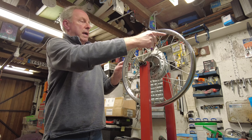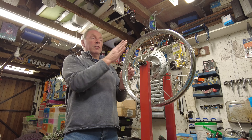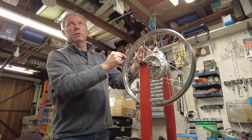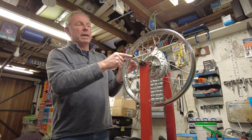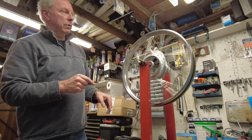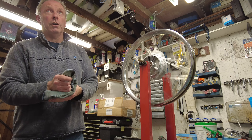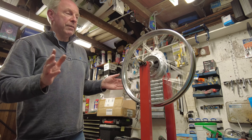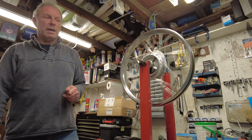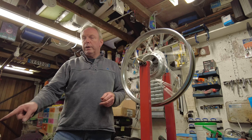Not quite true, but it's together anyway. With the wheel built and on the truing stand, the next step was to tighten and loosen spokes on opposite sides to remove any up-and-down or left-to-right motion. One part of the rear rim was particularly buckled — I reckon at some point it just hit a really big rock. It's the worst bit, kicking across that way, so what I've had to do to counter that is to loosen the spokes on that side — you sort of have to do the same amount on the other side too, but then you've also got the up-and-down which is a couple of millimetres.